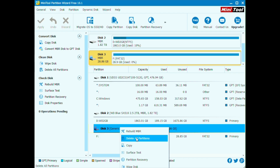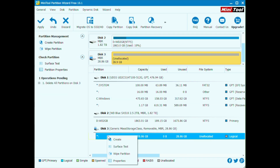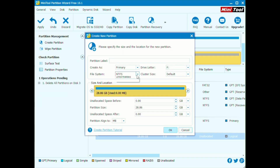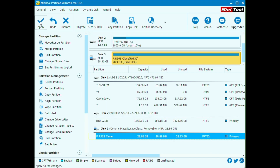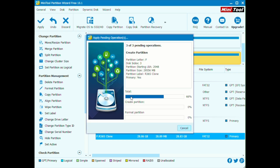Once you've backed up your microSD card, the next step is to reformat it. If you're using a new card, go ahead and format that one too — that's going to help minimize errors during the flashing process. You can use either FAT32 or exFAT; both will work just fine. Here I'm using the MiniTool Partition Wizard because it's simple and easy to use, but you can use any formatting program like SD Card Formatter or even Windows Explorer.